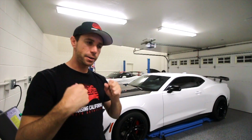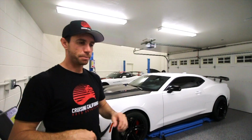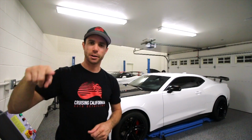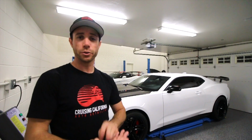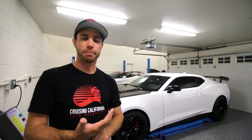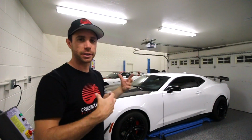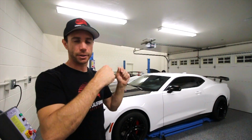And you pick up your pad, your polisher, and you grab your towel and you're wiping it down. You're looking at the paint with your light and you're like, wow, it looks great. And then you're like, wait, what is this right here? And you have this little very uniform pigtail mark that goes along and along and along. Basically one of two things causes that to happen: one, you did not fully decontaminate the paint, or two, possibly if you're working outside or maybe in the shop and something floated in, or a piece of dirt or some particle landed on the paint by the time you polished on it.